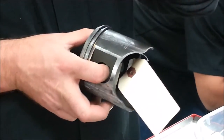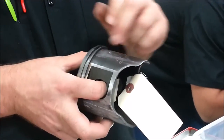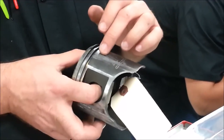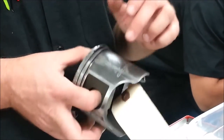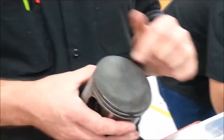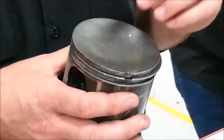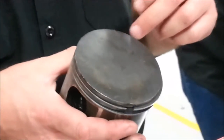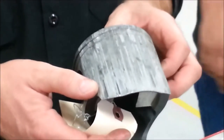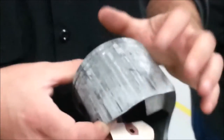You can see here that we had physical damage that got from the top of the piston and worked its way down, and basically took and smeared aluminum all the way across here. This is going to be hard on the cylinder to the point that it needs serviced, but the piston is taking the brunt of the damage. You see that's kind of a dull color and the piston is pretty dry — you bet this thing was running too lean and not having oil. When we look at this side, we definitely know that we didn't have oil on this piston. It is just smeared all over the place.